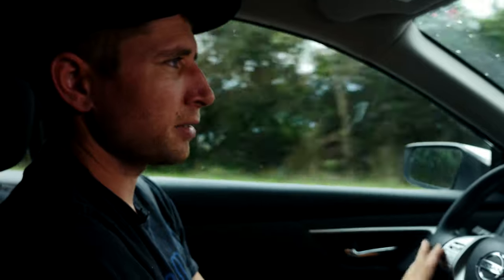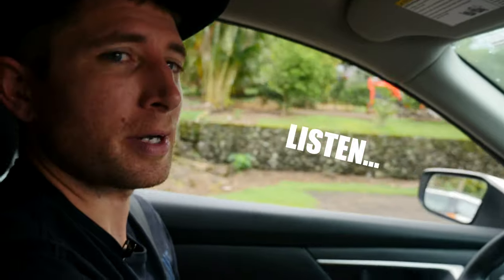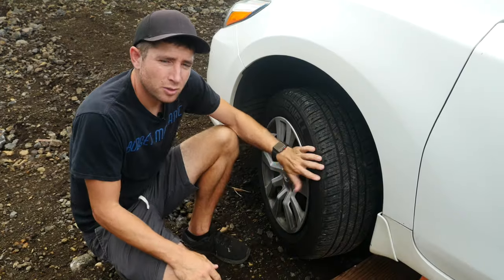It's hitting or grabbing or scraping or something. Now that we're all warmed up, it's pretty pronounced — even from inside the car I can tell it's up front, probably the left. When I hit the brake, it goes away; when I let up on the brake, it comes back. That would get old fast.